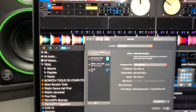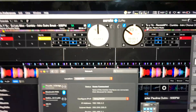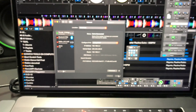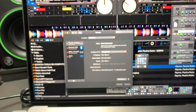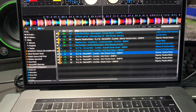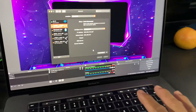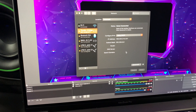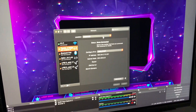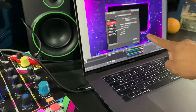After hitting Apply, you can see the Thunderbolt Bridge turned green — it's connected. I've got Wi-Fi off on this machine, so I'm running it offline; this is my main Serato mixing laptop. Now how do we send the video out? You've got the Thunderbolt Bridge. Typically I'll run the Ethernet connection because I've got it connected to my dock, but you can also share the internet from this laptop — through the cable and into the other computer — which is pretty cool. That's in the Sharing settings of this specific laptop.